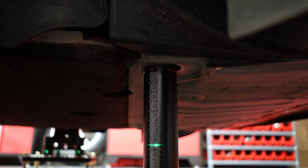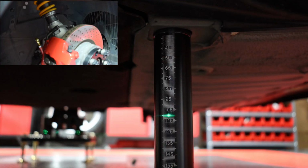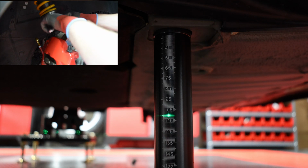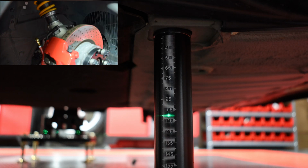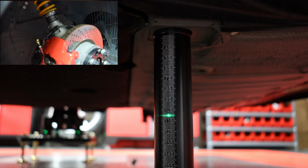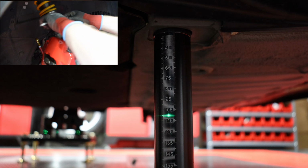But we're going to go ahead and check the front left as well before we make that movement, to make sure we can utilize the same movement back and forth. Okay, so we take the spanner wrench and we need to tighten it, which, since there's weight on the car, can use a little more force. And we also can see the gunk build up. This is from anti-seize and just road grime. So some recommendations: you can wipe it off with a microfiber, or wearing gloves also helps. It's kind of the nature of the beast with coilovers and anti-seize.